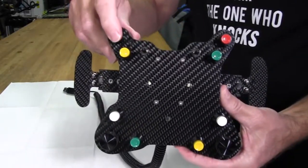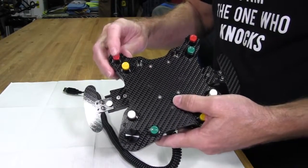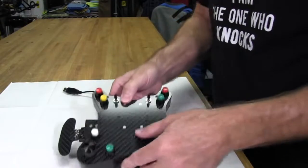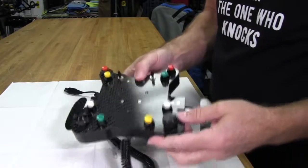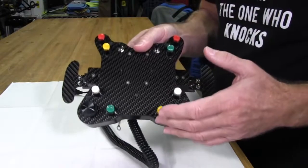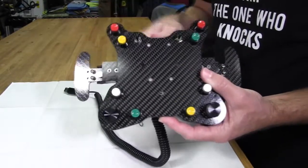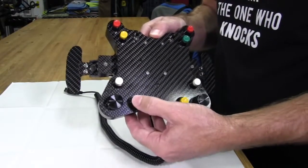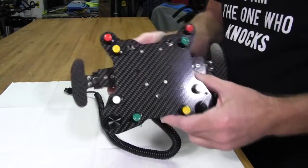We have knitter buttons here, and these knitter buttons have a great feel. They have a pretty strong spring compared to other knitters I've used — a nice resistance when it pushes back against your finger. I got the number off these knitter buttons: they're called MP S103F. Once I looked that up, I found them on Leo Bodnar's site, and he says they actually use these exact same knitters in real Formula One racing wheels, which makes sense because they have a great feel with no side slop. This is all top-of-the-line stuff on this plate.